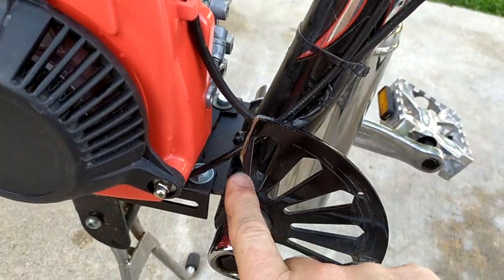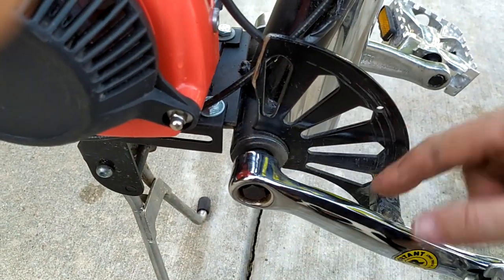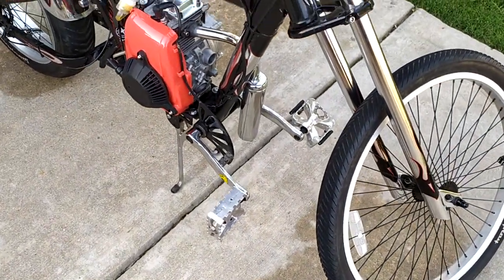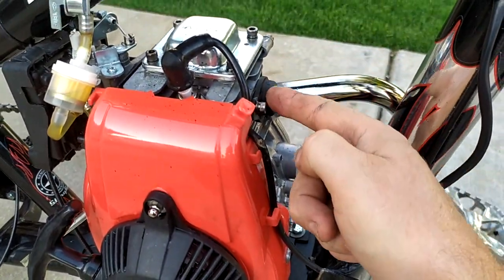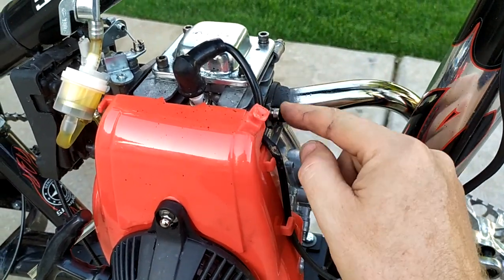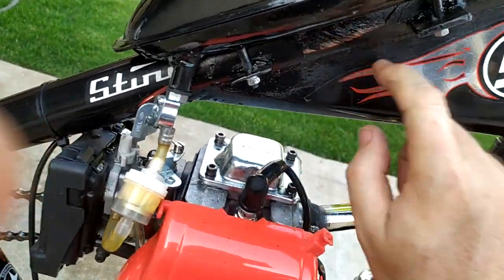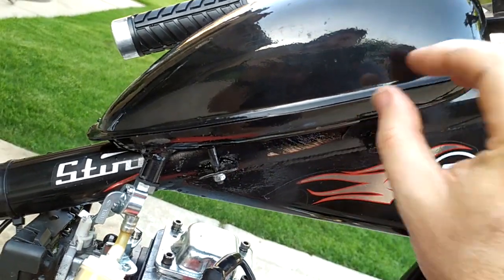I cut into the pedal guard, took the arms off, put them both on the same side, and welded a bracket — so now these are the foot pegs. They don't pedal anymore; that's what those are for. The exhaust didn't fit — I had to cut it here, bend it open, tack it in place, take it off, fill it in, and paint over it, because it didn't fit there either. The gas tank didn't fit, so I had to weld little tabs on both sides to mount it.